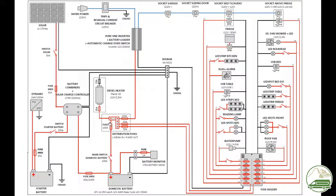To charge our domestic battery we have three options. The first option is charging via the starter battery and the dynamo of the van. The second and main option is charging via our solar panels. And the third option is using the shore power to charge the battery via the inverter — that's a 3-in-1 inverter, so it includes an automatic changeover switch and a battery charger. We consider shore power a sort of a backup system for charging the batteries. In our regular use we expect to be able to keep the batteries fully charged by solar and our dynamo.